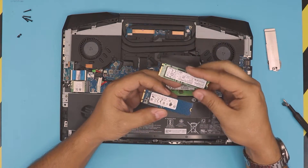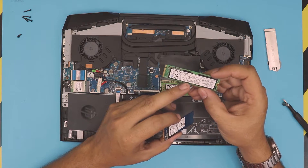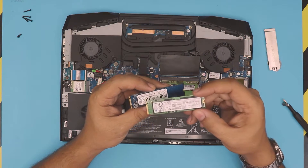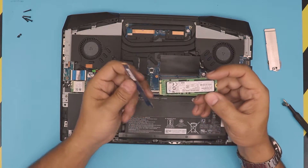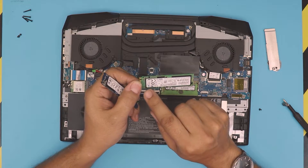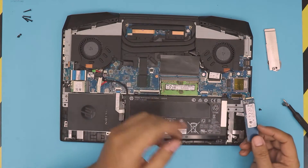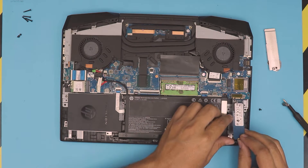You can upgrade to a better version. Samsung gives you a really nice one — this is a 512-gigabyte NVMe drive, and it has a DRAM cache, which the stock drive doesn't have. The stock one just has a single NAND chip and nothing at the back. The Samsung gives you NAND chips, a controller, and a DRAM chip, so it's better to have a higher-quality one.